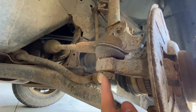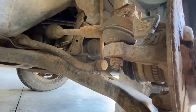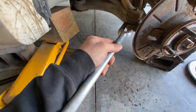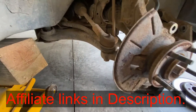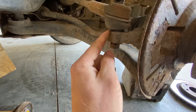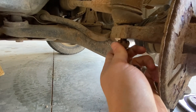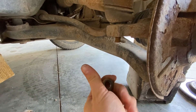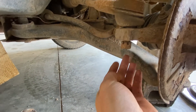Next thing we're going to do is unhook our tie rod end. Bend the cotter pin out and take it out, then take this nut off. For getting it actually popped loose, you've got a couple options — you can bang it out with a hammer, or you can use a pickle fork, which you slide in here and pound in, and that wedge pops the tie rod up. I'll have a link in the description to where you can get a pickle fork. I opted for banging it up because I'm not replacing this and I didn't want to rip the boot. Put the nut on backwards so it's biting into the threads and then pound up — that way you don't mushroom it out and ruin the threads.